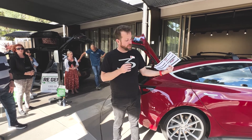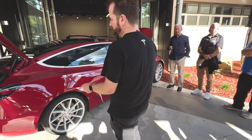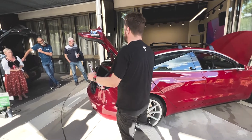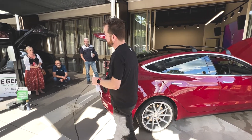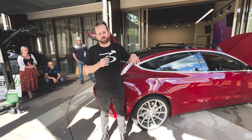The only other thing is scheduled maintenance. One of the joys of owning an EV is that the only scheduled maintenance is that the brake fluid needs testing every two years. Because the brake fluid goes off — it absorbs water, the water attracts rust and will rust out the inside of the brake system — so that needs checking every two years and replacing as necessary. There's also a cabin filter that should be replaced every two years; it's an air filter for the fresh air that comes into the cabin.